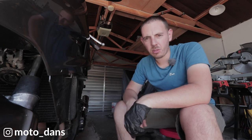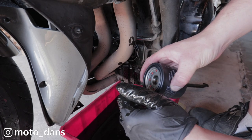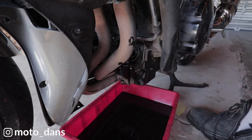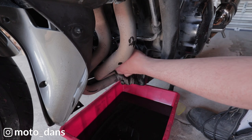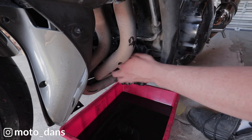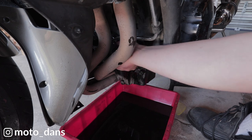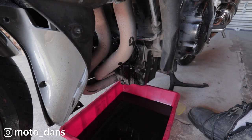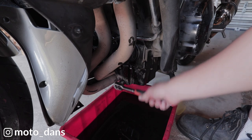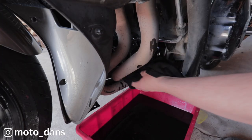Right, new washer on, and we'll put this sump bung back in. Right, I've got my new filter here. I'm just going to get a wee bit of the old oil and just rub around this seal here. It just helps it come off good next time. All I'm going to do is just screw that on, basically hand tight. I've got a genuine oil filter here. I only ever really use OEM stuff on any of my vehicles, so just now you nip up with your hand, and that's as tight as you can go with that. And the sump bung, don't go crazy. I'll leave the torque in the description. Just a 3/8 ratchet and just a wee nip like that. Get it all wiped down.